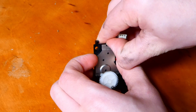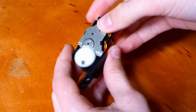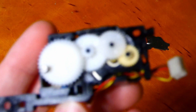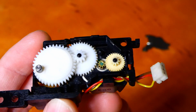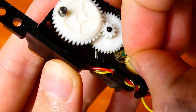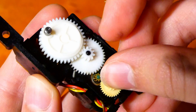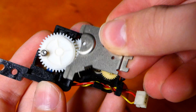I'm going to be showing you the process using an already-existing Macintosh gear, but of course if you have a replacement you would use that instead. Taking these apart is pretty simple — just unclip the little clip that lets the metal plate come off. Be careful as the plastic does tend to go brittle over time and you can break the tab off. Once inside you'll see a few gears. Remove one of them to access the one we need to replace — it's easy to identify as it's turned a different color and is the smallest one. Lift it out and reinstall the new one in its place, then put the other gear back and reattach the door.